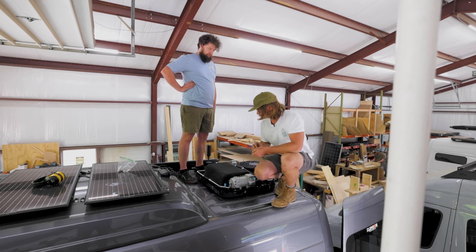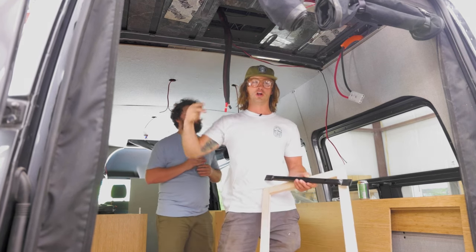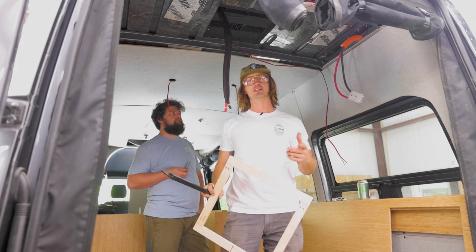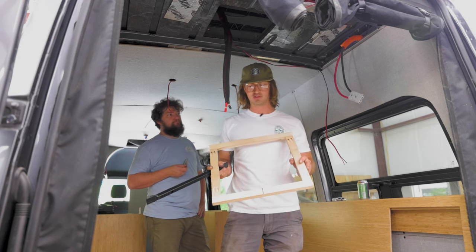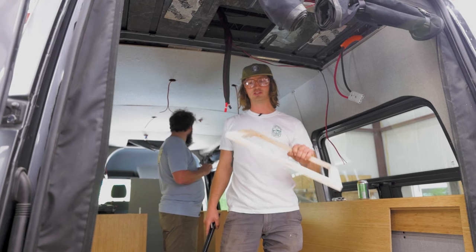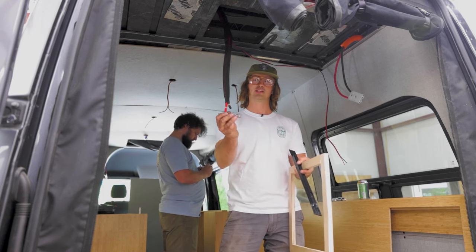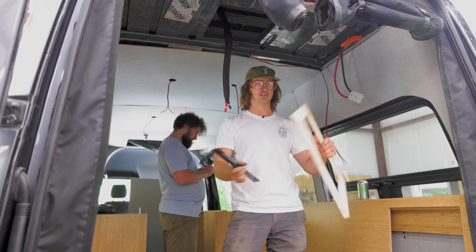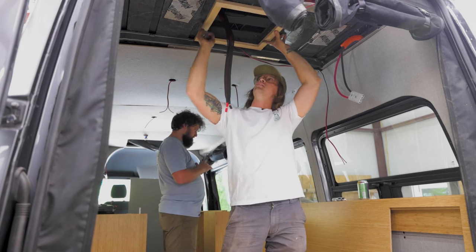We're inside the van now. The air conditioner is centered and squared off the walls — from the top and the bottom it all looks good. The next step is getting this to compress against the ceiling so that the adhesive sealant does not solidify. You have to work somewhat quick — definitely take your time, but don't take too much time or it's going to solidify and there'll be issues making a good bond against the metal and the foam gasket. This trim piece is going to go up first, against the ceiling. We already pre-threaded the nut on the bolt all the way to the back facing the same direction.